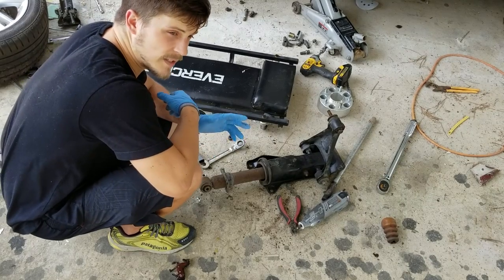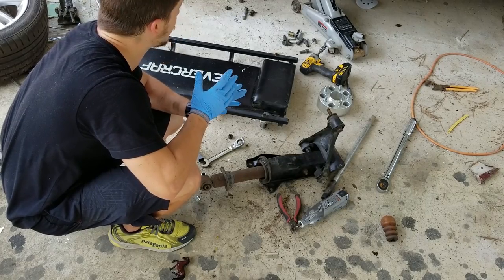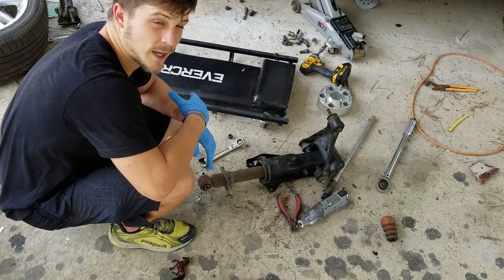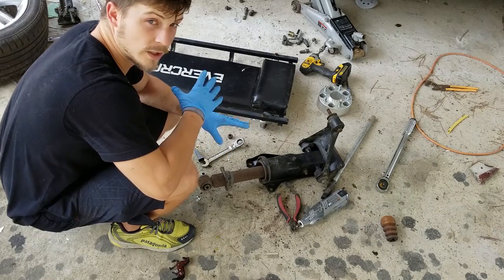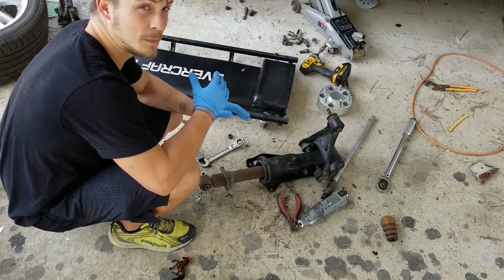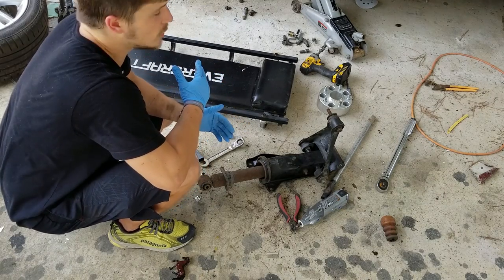About moving the shock tower up, but if I cut a hole and move the shock tower up into the trunk, basically, I'll also have to cut out the wheel wells, and you're getting into a lot of fabrication work that I don't want to get into. So it looks like at this point it's going to mean lowering the car as much as I can and then building the fender down to meet the tire, kind of pulling this line down a little bit. I think it's doable. I think it'll work.